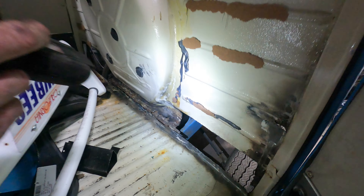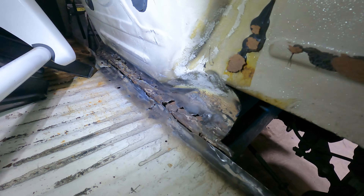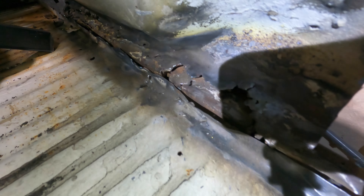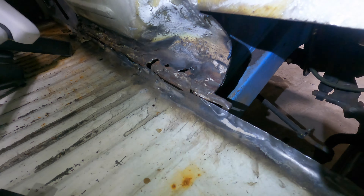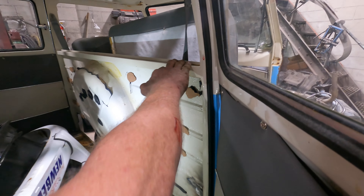This is the separation panel, it goes from the front to back. At the bottom it's completely rotted — they covered it up, it was full of bondo and seam sealer. We know about the ends with the wheel wells. The problem is they don't make that panel — it goes all across like that — so you have to replace the whole thing.